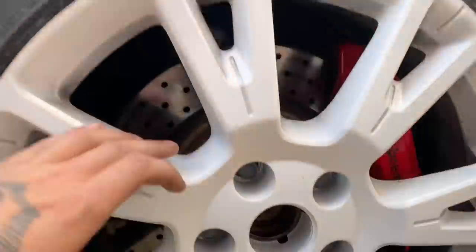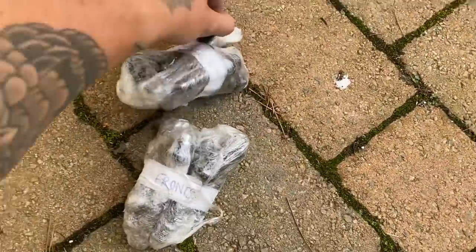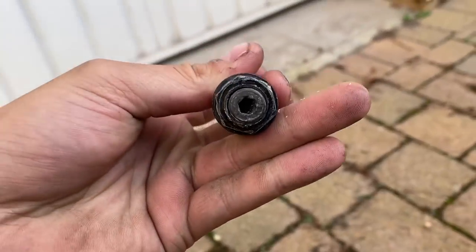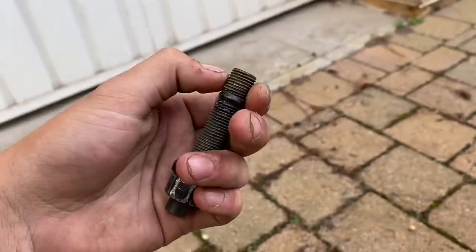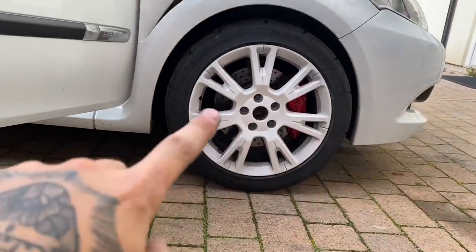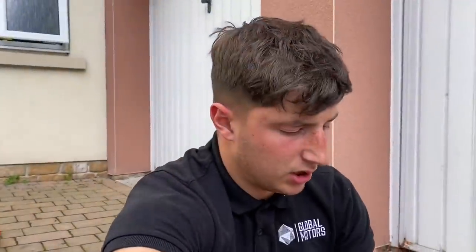At the moment these have actual wheel bolts. I've gone ahead and got some studs from Ollie — Ollie Garish — who's got a sick clean white one, pretty much white on white like mine. I got inspiration from him as well. Basically these studs have an allen key on the end, covered in loctite and threaded into the hub. The reason for having these is that when you're on track changing between sets of wheels, it's a lot easier and faster to use offset nuts instead of bolts, and apparently a lot safer than having longer wheel bolts in the hub.